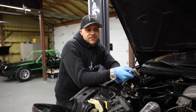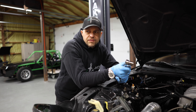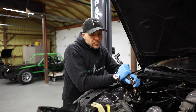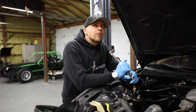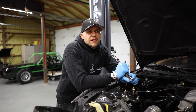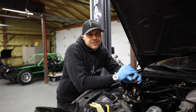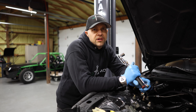This is stuff I don't think anybody's ever encountered — or maybe they have and just never said anything. The outlet of the full TO4S is considerably bigger, and we'll show you that shortly. So we're going to a full TO4S. This car with this cover at 15–16 pounds of boost made 417 at the wheels — uncorrected, it was really cold out; corrected was around 402. And 328 pound-feet of torque somewhere in that vicinity. What RPM was the torque at? Probably around 7,500. After 7,500 power starts to taper off a little bit.